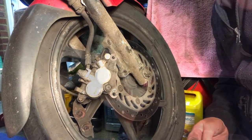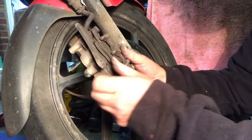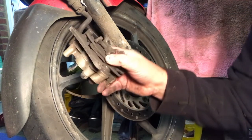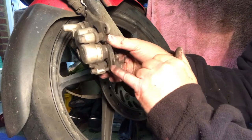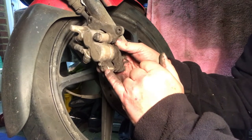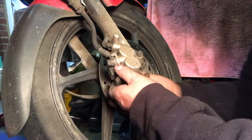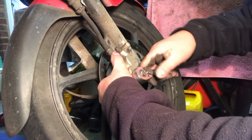I just want to show what I'm doing for people who'll be doing this at home. This is the brake assembly as it comes off as one unit. Important: clock how these brake pads go in. It looks like we have a locating bolt here that holds these brake pads in position at the bottom, and the other two just slide and lock in. We need to nip this little bolt off - it goes straight through all the way to the other side. We can't get these brake pads out until we've undone that.